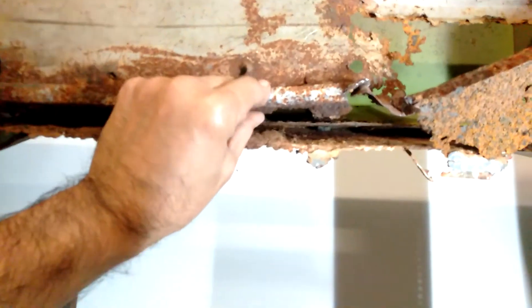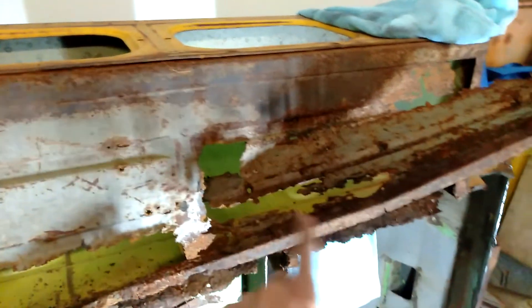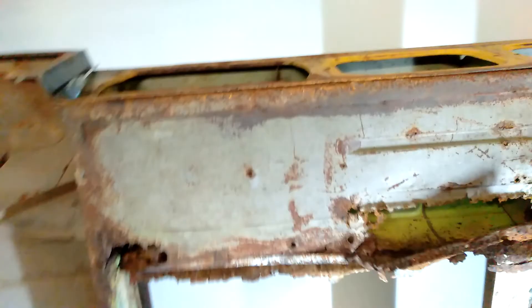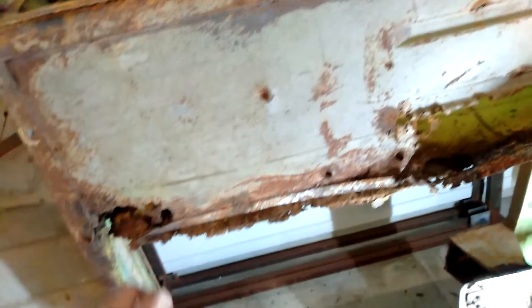Inside this cavity here you can see like a sandwich section - that's the Bermuda triangle. Along this edge here, the floor would normally be welded to this angled piece, and then that build completes the frame to allow the side floor panel to fit in there. So it's pretty basic but I need to remove all this. I'm going to work out what to do with the battery compartment - whether or not those pieces need to come out of the floor - but I'll start pulling all this out because I need to get to the old floor vertical part to remove it.